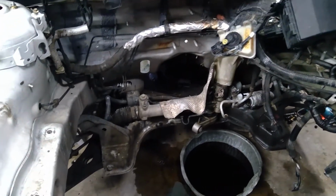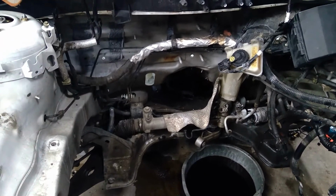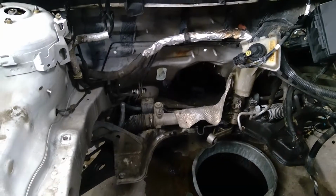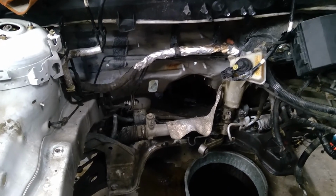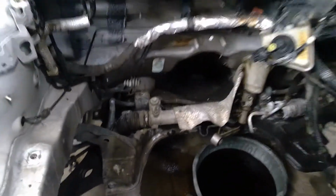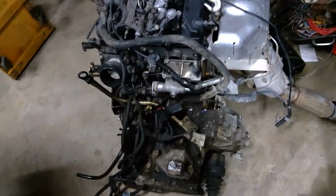It's something I learned with the front four guys giving me a little bit of information on that, and I was hesitant to remove the sway bar on the old car, but I did, and it really freed up the front end and made the car understeer less. It chattered less in the corner. So on this race car, it'll be built without a sway bar in the front, a big sway bar in the rear.